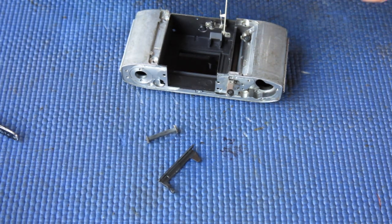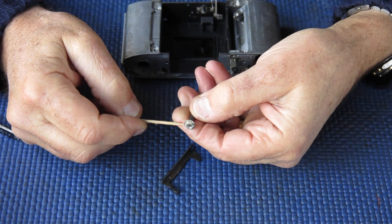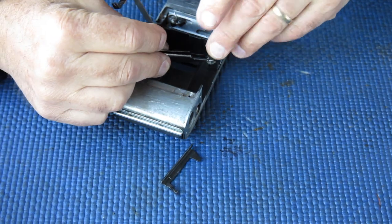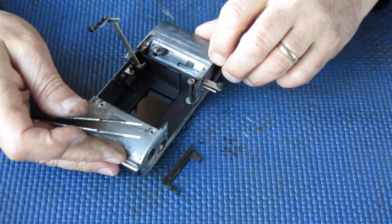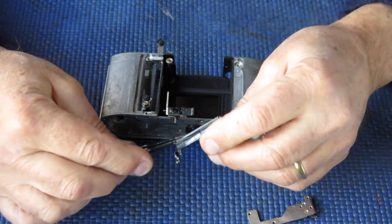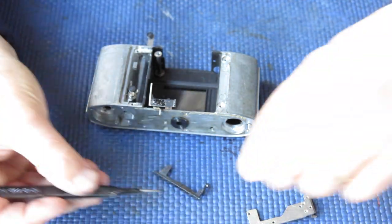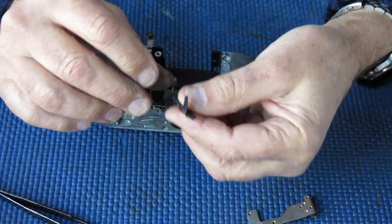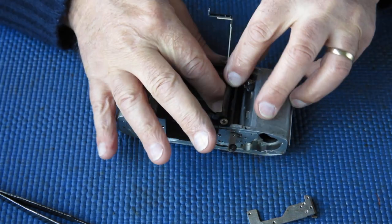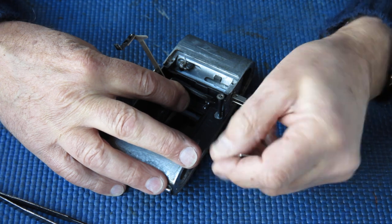This, the transfer shaft. Double-ended gears at both ends of this thing. The piece with the flange on it goes back towards the body at the back. Those up in that corner. And that is held in place by this piece. But at the moment we're interested in getting this arm in place. Now I had a tiny washer, a spacer, it goes underneath that. And then that goes into a hole in that arm there. And the top of that arm goes into a little pinhole here.